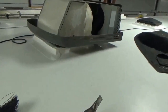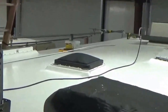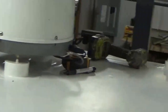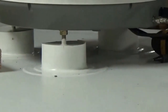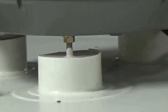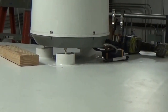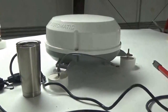Okay, so we got all our curbs welded in. We got the air conditioners mounted. And we made these special boots to keep the system up off the roof, so you can wash underneath it. And also, if you ever had an issue, you can change them out. There's some adjustment bolts right there. So in case you had to either re-level it, or change it out, you could just do that real easy without ripping the roof apart. Same thing here. There's another.